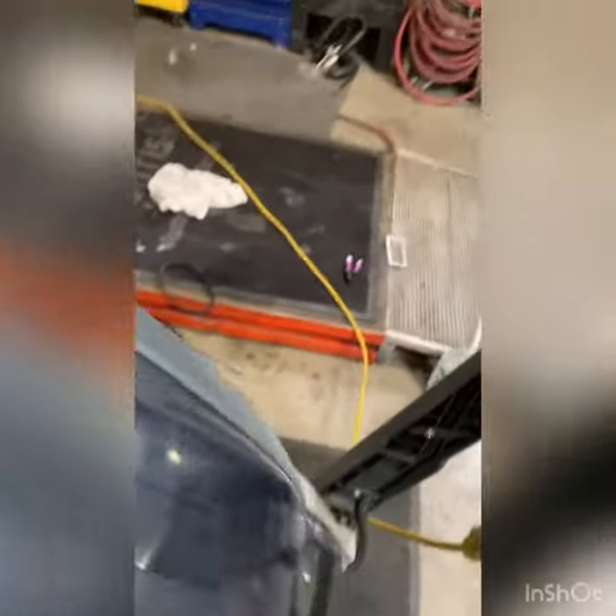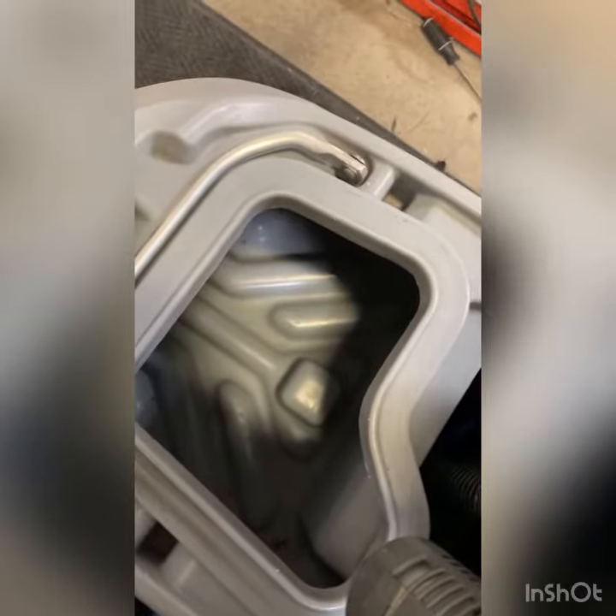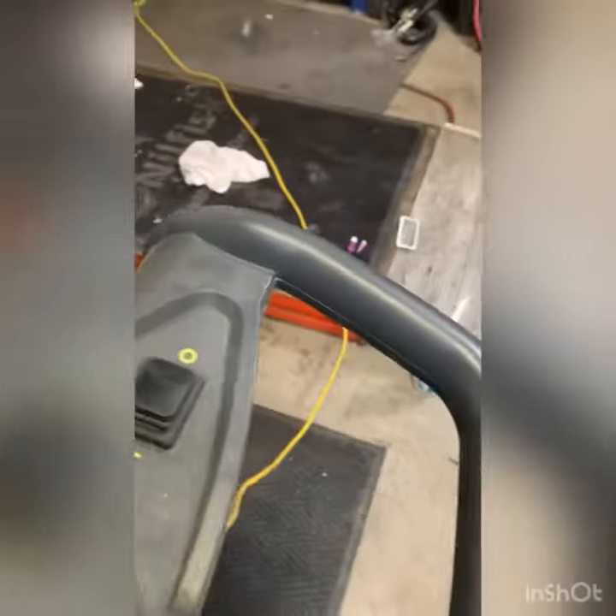Also, if they are going to be using a lot of solution — which I noticed, there's some solution residue inside the tank — you have to use defoamer inside this tank. That will save your vac motor from future troubles.